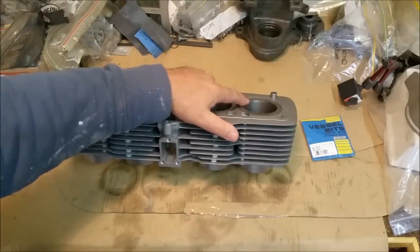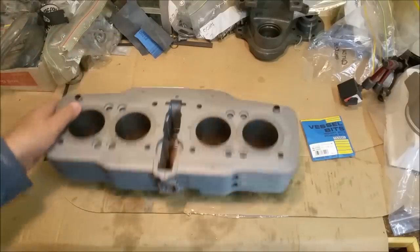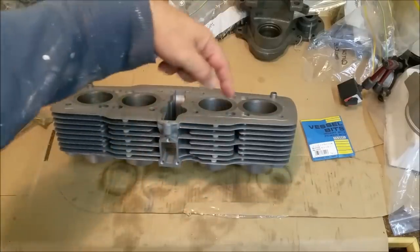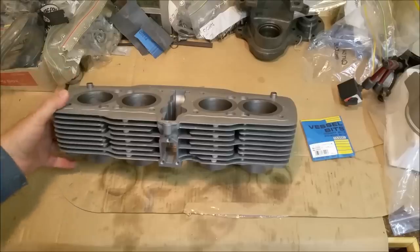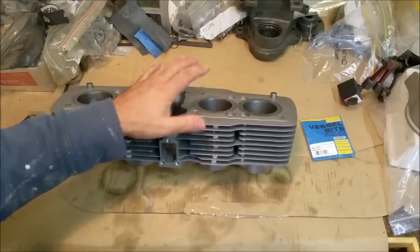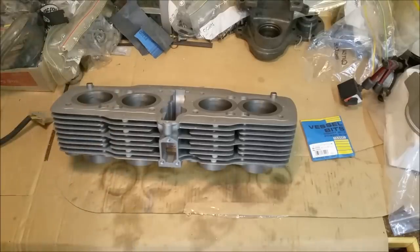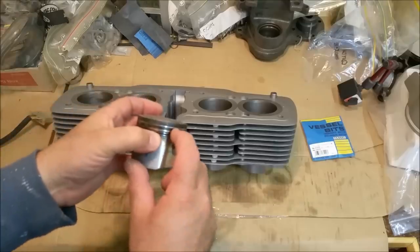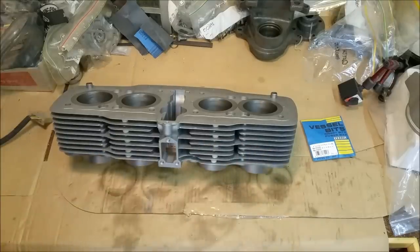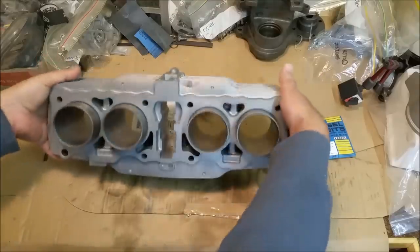Now honing — this is more of a 45-degree crosshatch pattern, which is where you want it. A lot of it depends which site you read, but if you have too much of an annular type hone pattern they will hold too much oil and you'll burn oil. Too vertical an angle means you're not getting enough lubrication — it's running off too quickly. Some sites even say a very shallow pattern can get chattering in your rings which causes your lands to wear. I re-did it and it all clearances really well, so I'm very happy with the way that's turned out.